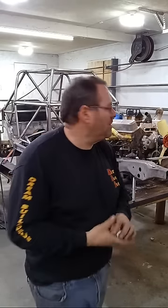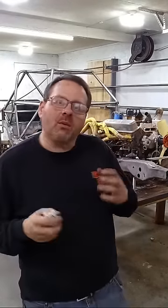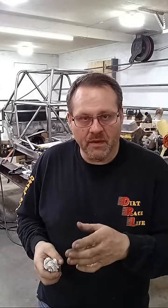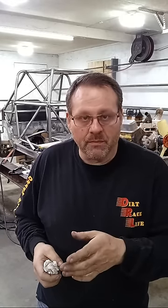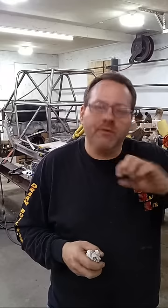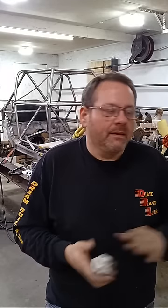So when I shoot this, I'm trying to work out how to explain that all you care about is what that tire is doing. So understand the things that control that. Figure out what you want it to do. Make the changes to make that tire do that. And don't have nightmares for the next 3 months wondering if your roll center is off an inch, because it is a fictitious fugazi that really isn't doing anything.